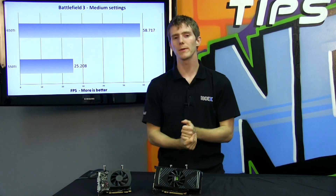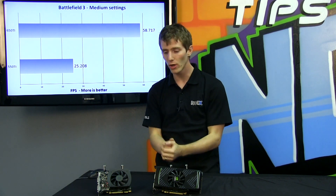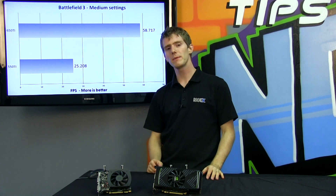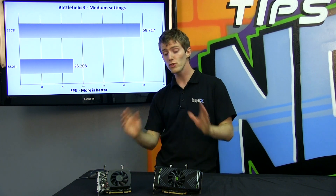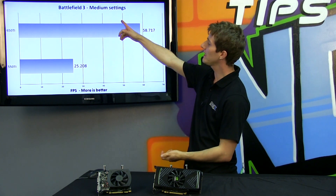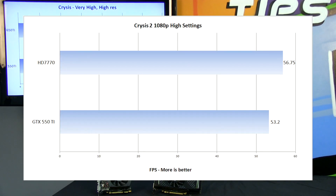If you're a serious gamer, it's not about what your card looks like — it's about how fast it goes. We only tested a couple of games to get some idea. This card is coming in at a higher price with a newer architecture, Kepler versus Fermi. At 1080p medium settings — really where an X50 Ti card is positioned — we're looking at more than a doubling of performance going from 550 Ti to 650 Ti. In Crysis, we're looking at a doubling in performance at very high 1080p.